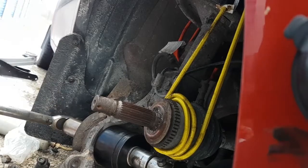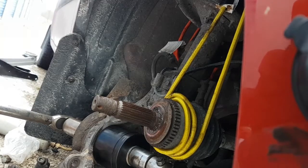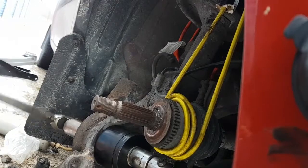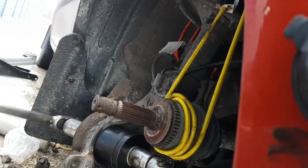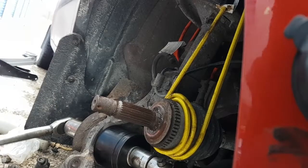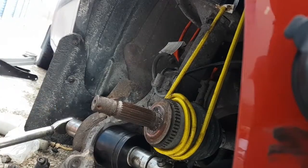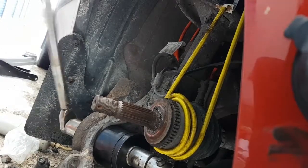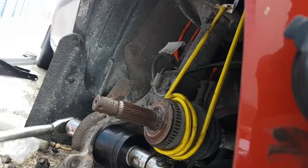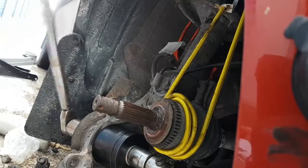So if you're reefing on the thing, trying to get it to come out, you might want to have a look and see what's going on in there. So don't go ape crazy with, you know, the 4 foot long breaker bars. On the hydraulic press, cars that have never been changed before, all the cars I've worked on, they always seem to be about the same to get them to break loose. You get the odd one that's a little more, but it's not like an insane amount. And given how much force it took to break this loose, I'd say if you're cranking much more than 100 foot-pounds, 150 max on this wrench, there's something probably not right. You're not pressing something right. So just kind of keep that in mind. You don't want to break the tool, right? Because this is one of these jobs that if you only got one car, it has to get done. There's no option, right?